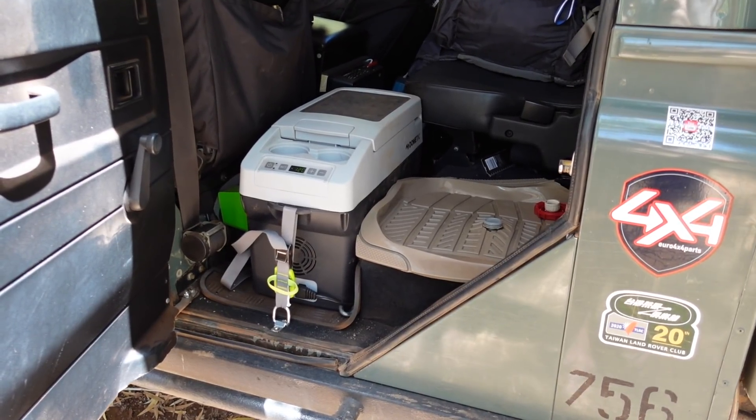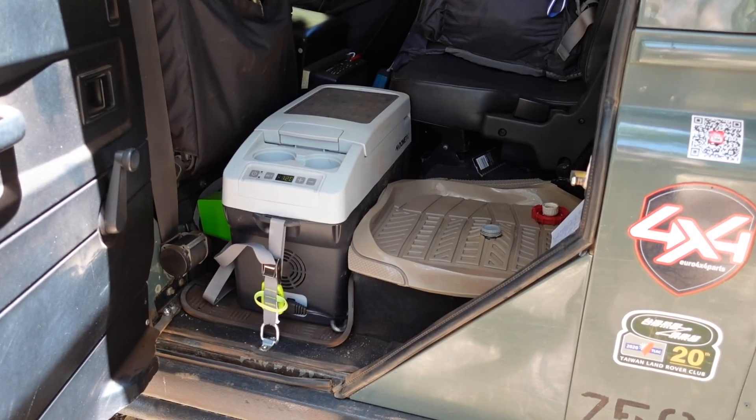This new fridge is running very inefficiently. Granted, it's getting pretty warm where we are — up in north-western Australia we're getting about 38 to 39 degrees most days — but I have to say I'm very disappointed in the fridge. In my opinion it has very poor insulation compared to other similar fridges on the market. It pulls roughly two to three amps when running, which isn't too bad, but the problem is it's been running almost non-stop. In my experience, top-loading fridge freezers can be extremely efficient in comparison to upright fridges.